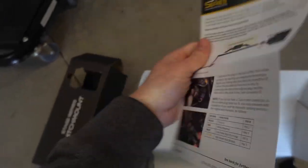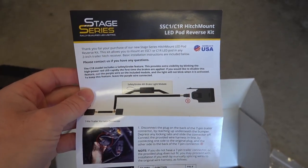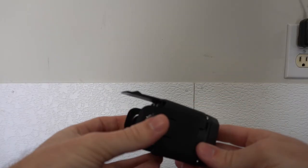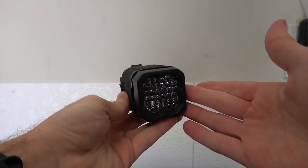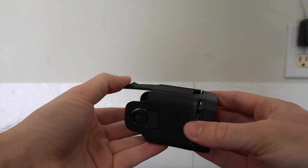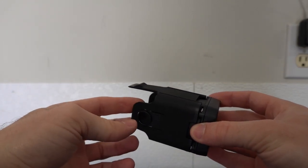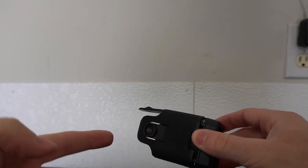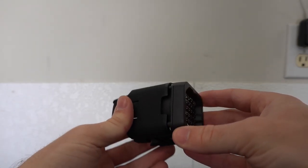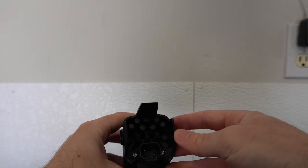This is a very simple application. It goes over exactly what this product is — the harness comes out of the vehicle, goes into this, and then retains usage of the seven-pin from the factory. This is the standard SSC1 single LED pod from Diode Dynamics, and they've created a nice insert that allows you to basically slide it into a two-inch receiver where it clicks and locks into place. There are some questions about using a locking pin — you can just cut off the two tabs on either side of the plastic insert, and that will allow you to slide your pin through and lock it like a normal trailer hitch would. So people can't easily steal this product, but you can also just use it as is.